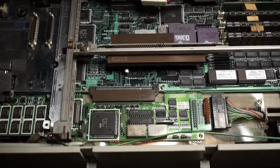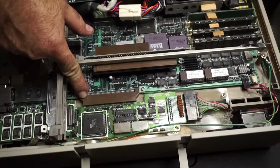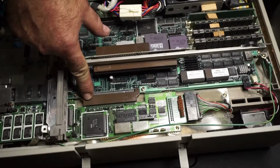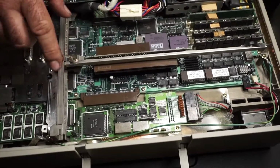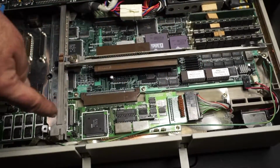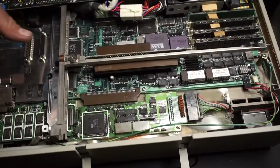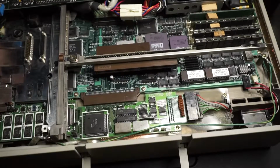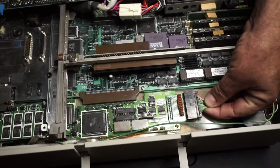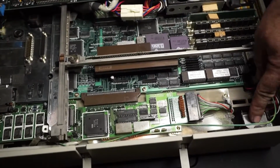And then down here, you'll notice what looks like another 16-bit microchannel slot, and it is. This is a third microchannel slot. This actually has 4 slots technically. So this has the video card. This is the video card right here, and it goes underneath this piece and all the way over here to where the VGA connector is. So it's a standard 256K memory VGA video card. It's more or less an 8514A, but it has a special connector here for the plasma screen in the front. And then there are some ROM chips here, and right here is the battery.